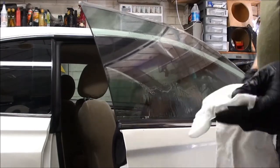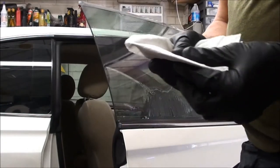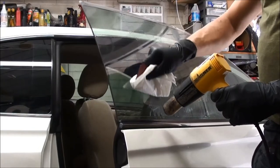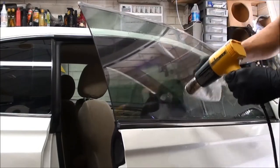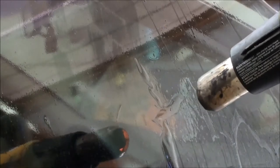The way I do it: take a hard card, get a nice thick paper towel, fold it, put it inside there, then put on my heat gun right here. I just heat down — hitting across and down, across and down, across and down. Just so you can see, there's one of those fingers right there. When I heat it you'll see what it does — it's squiggly, push it down, squiggly and then push it down. I put it on there and push down. If you've got really big fingers you've got to be careful — sometimes you've got to break them down, but it's pretty much molded. It's pretty quick.